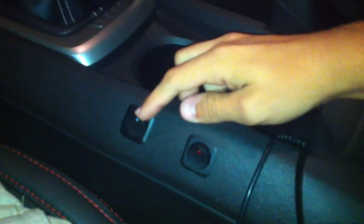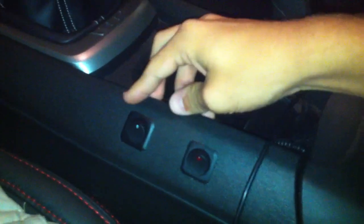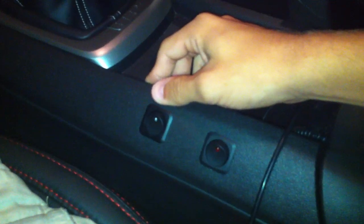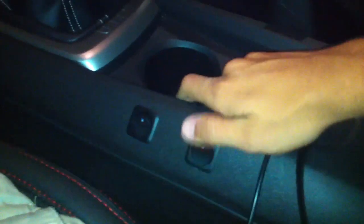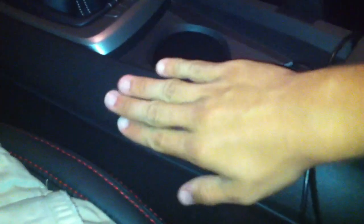So pretty much what I did: out of the new rings, there are 3 wires. One is a power wire, one is a wire that, when connected with the power wire, will activate the white, and one will activate the red. I ran the red wire to the power source, took the other 2 wires to their desired switches, and then grounded these out. That seems to work pretty well, but here's what the new reds look like.